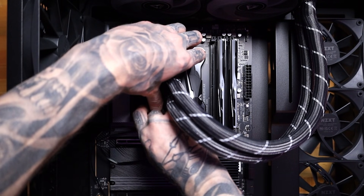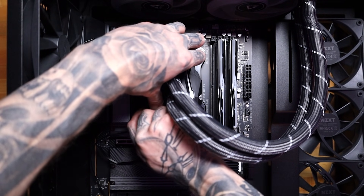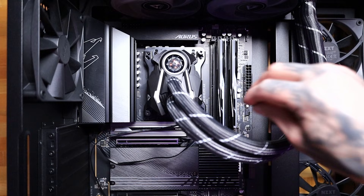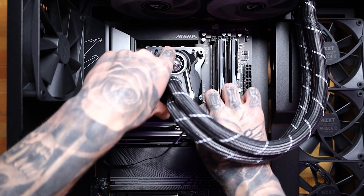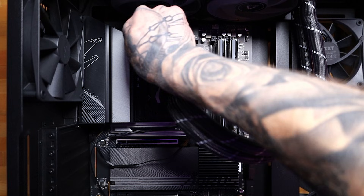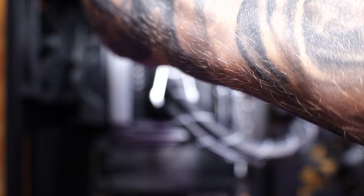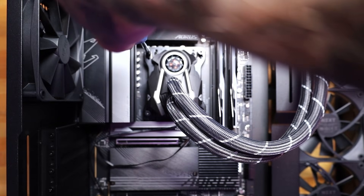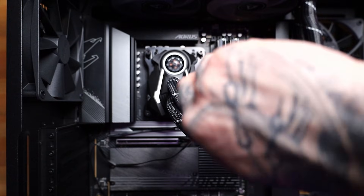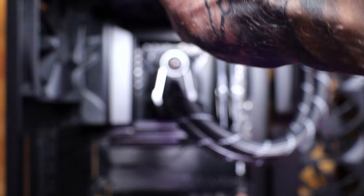Take our thumb screws on each corner. When screwing things in, you want to go crisscross — diagonal — just so that even pressure is applied as you're screwing it in. I got those two on, we'll screw these on and then tighten with a screwdriver. Go top left, tighten it down, then go bottom right. Make sure it's nice and tight — you want that copper plate making good contact with your CPU. Don't over-crank it, but definitely tighten it down nice.